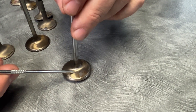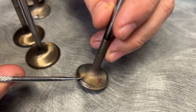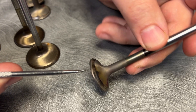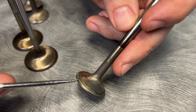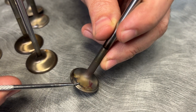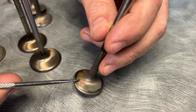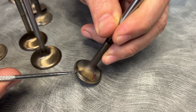The exhaust is going to take the brunt of the heat and all the damage, because where do you think the flame goes when it's backfiring and doing all kinds of crazy stuff? It's going to go on the exhaust side, and that's why you see color on the backside of the valve. Look at this one — this one was about to burn. If you got something hot enough to burn a Ferrea valve, you are getting at it. Ferrea valves are not easy to burn; I've seen just a few of them in my career, and this one right here was starting to burn.